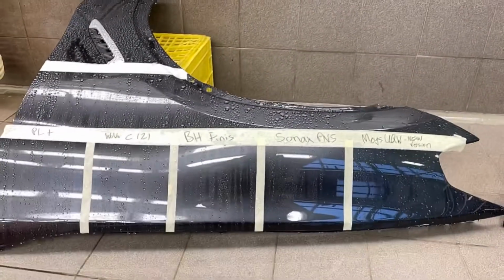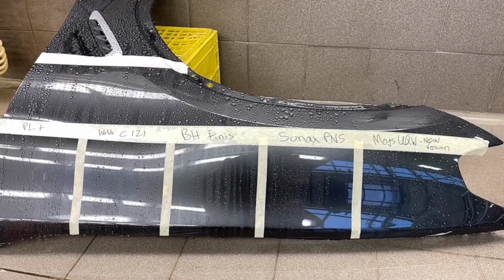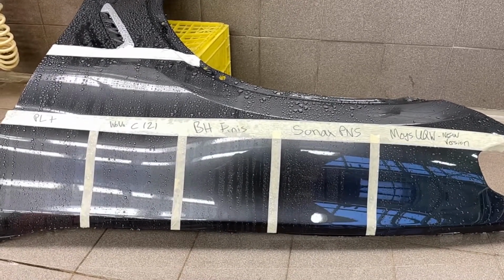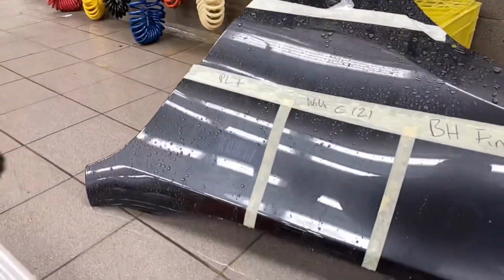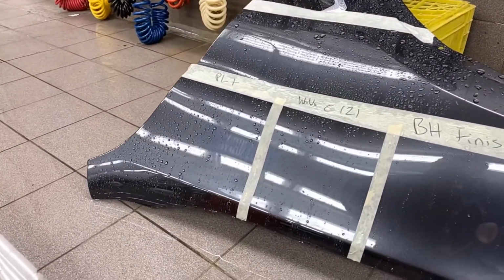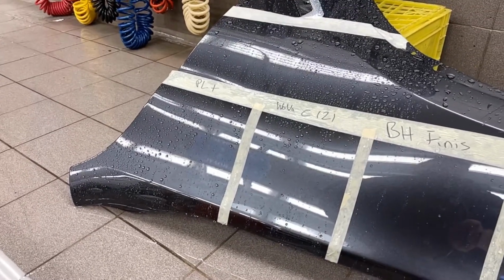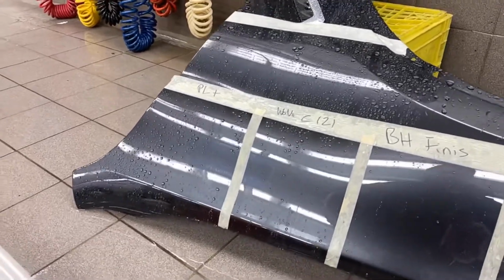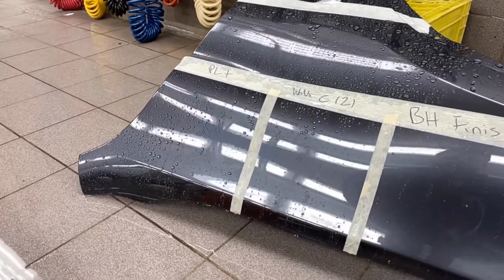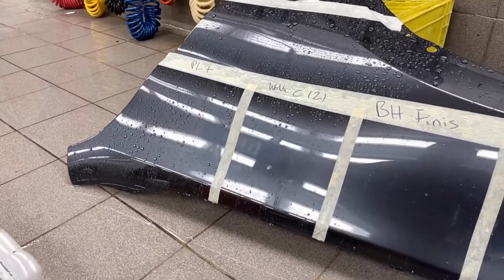I'm gonna go ahead and do a couple more APC hits off camera, and then after a few I will let you know how many it was and we'll check the results. Okay, so I did another 3 hits of the APC, which I don't know if I mentioned is 10:1 concentration, so not straight, but your typical use case for doing an engine bay or some wheels and tires, and you know, if you got overspray on your paint, this would be a very typical scenario.